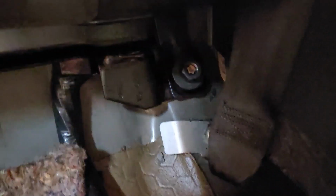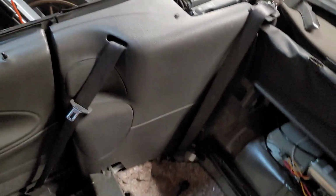After you take out the bottom seats, there's two bolts for the back seat. So you're gonna see those two nuts. Take those nuts off, and then this back part will slide off. That's a pretty easy thing to do, so I'm gonna go ahead and get started. So down here behind the backrest, you have two bolts on the right and on the left. I'm using a 3/4 socket, and those are easy to get out, so just crack them open. Alright, so that part was pretty easy.